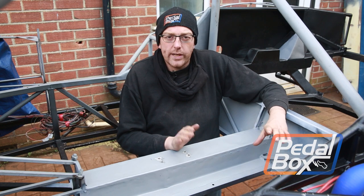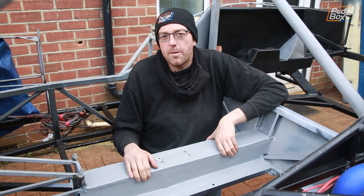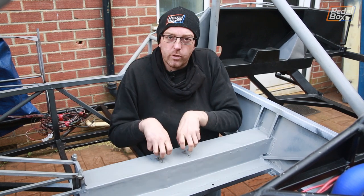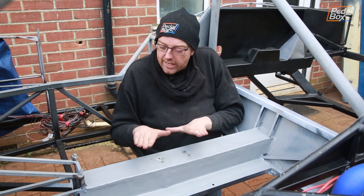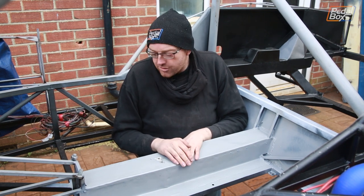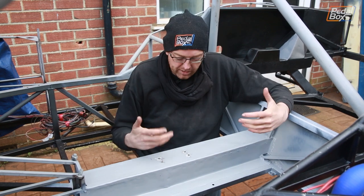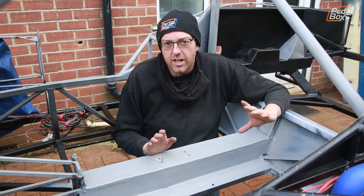First up this episode we're going to take a quick look over the tunnel which I installed last week — it took me two days to beat this into shape. I had done a lot of work previously bending it to fit, but it was still sitting proud off the top, so there would have been a big gap and the handbrake wouldn't have been able to bolt down securely. I spent two days beating and welding this in, mostly off camera because it was obnoxiously loud, miserable work in inclement weather. It's all in now, all seam sealed all the way down the side, and there are a few more bits we can get installed so we can start moving on to the harnesses.